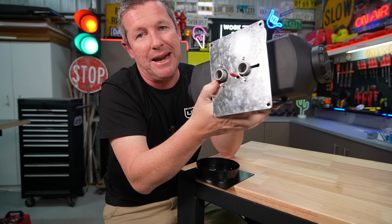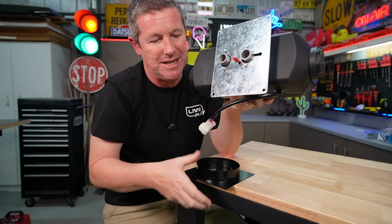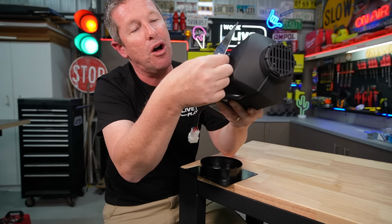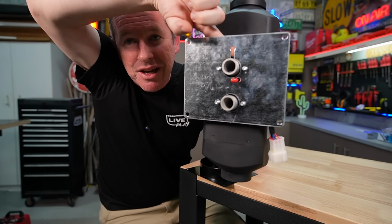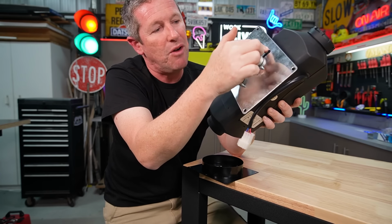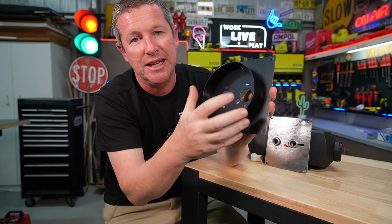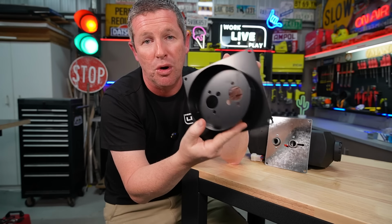Now, I've had this around for quite some time, and fortunately I actually bought the right one, because if you look at the bottom of this mounting plate, there's actually this slot that comes out on a lot of the adapters and aftermarket mounting plates you get. But these units actually have a rubber gasket on the bottom of them, and this will quite often, as you can see, go out past. So if I put my finger down here, you can actually see my finger coming through. So if you seal this onto the bottom of the Caravan, you often have a little bit of a hole, and that particularly relates to these floor mounts, where if that slot goes out and you seal it in, you do have a bit of an area where weather can penetrate into the floor of your Caravan or camper trailer.